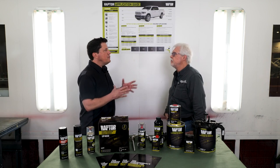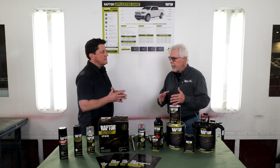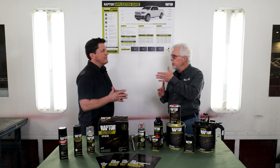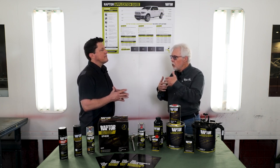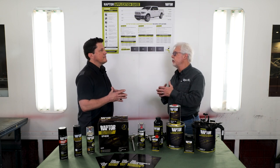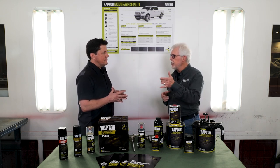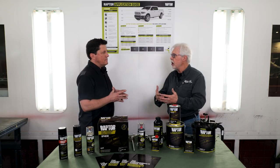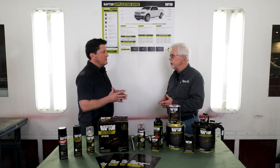Mark, that's really great information. What are you and Kevin going to demonstrate today? What we're going to do is show how to incorporate the material and the information on our wall chart into an actual application. We're going to use our 4880 gun and the 3M HO Performance gun to show how you achieve a variety of textures from very thin to very coarse. Once we've got the material on there, we'll allow it to dry for approximately 30 minutes, apply base coat over the door including the texture, let that flash off, and clear coat it — so you'll be able to see exactly the process to generate texture replacement on a door, a quarter, a rocker panel, whatever the operator needs to work with.